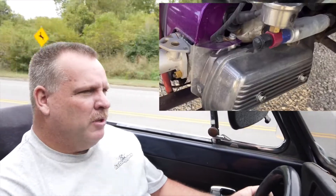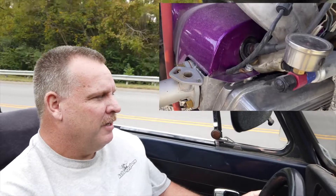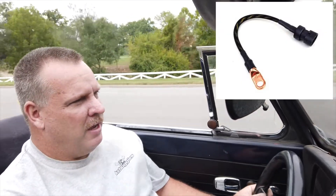I'm also running a coolant temperature sensor. Since it's an air-cooled engine, there are only a couple of different ways to really get warm-up enrichment — you can run off the oil temperature or off the cylinder head temperature. The Dub Shop sells a pretty nice coolant temperature sensor that mounts on the cylinder head mounting holes. That works really well. It runs about 140 degrees, give or take, on a normal day once it's fully warmed up.